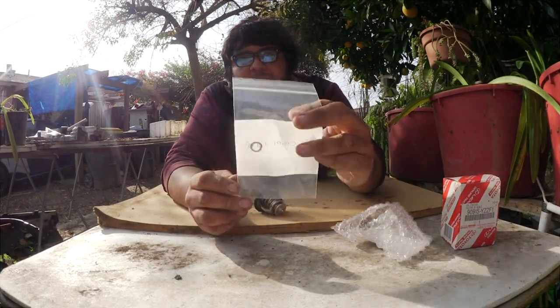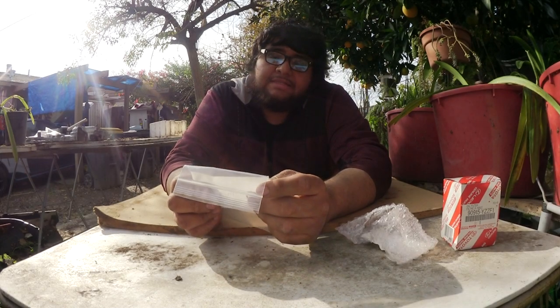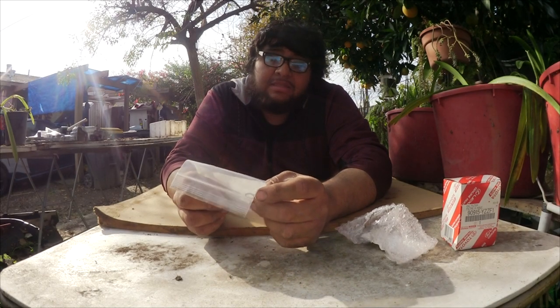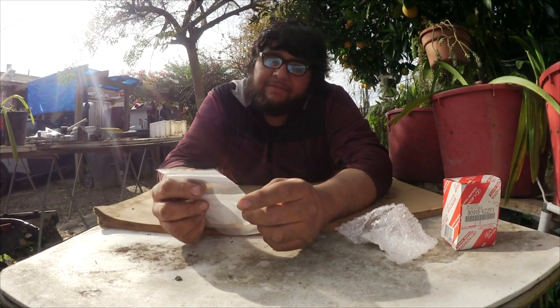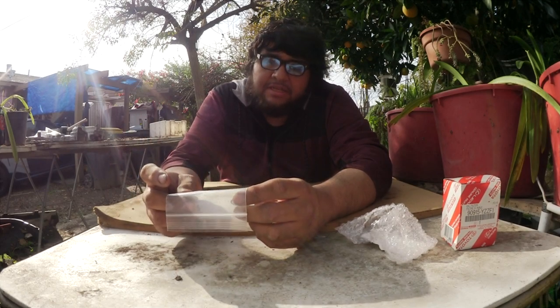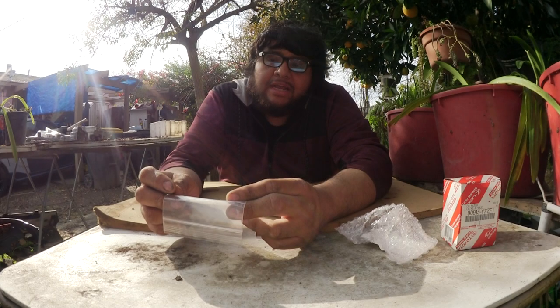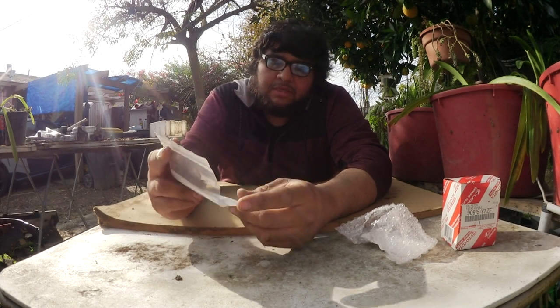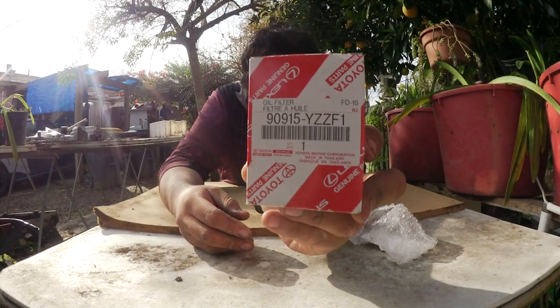And this part number right here is for your oil dipstick. It is a rubber O-ring, and I've had the dipstick drip oil out of it. It's happening on my Corolla XRS, but I figured since I'm already there, I might as well just change it. It is 96721-19010. Gonna go ahead and say that. And this is the oil filter we're gonna use for the 2ZZ.